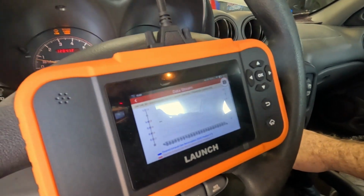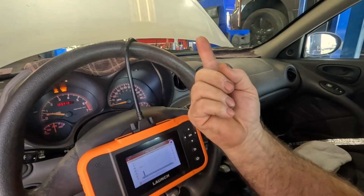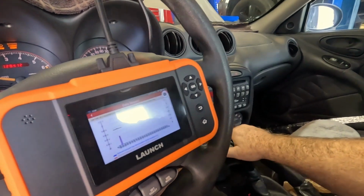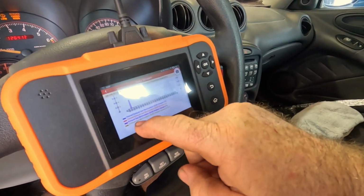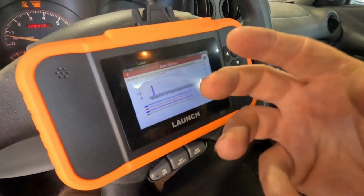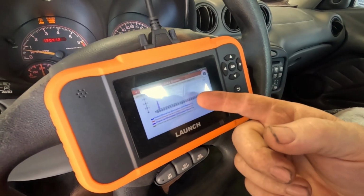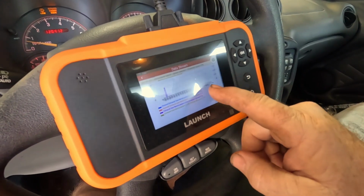And we want desired and actual to be accurate. If the exhaust is restricted, what these will do is it'll push the EGR valve open, and that might be masking the restricted exhaust. Very, very possible. Let's see what our colors are supposed to be. Recirculation position desired. The top two, the blue and orange, it had 2 data PIDs for it. I'm not sure why. The top 2 are where it wants to be, and the bottom 2, purple and gold, are where it actually is.